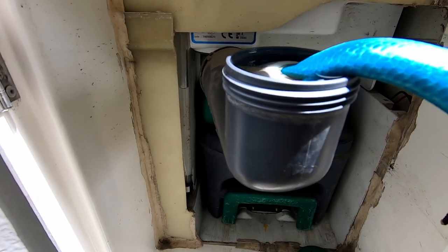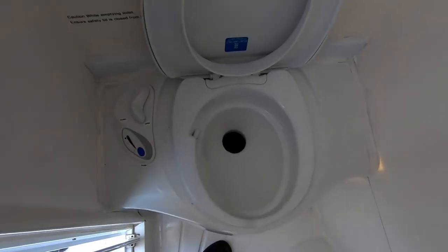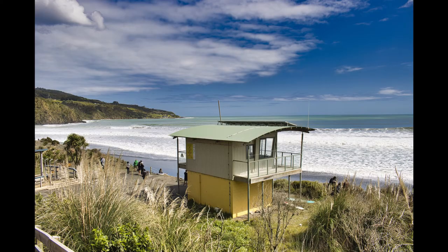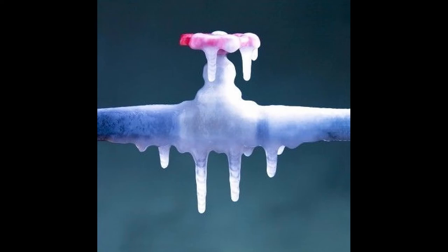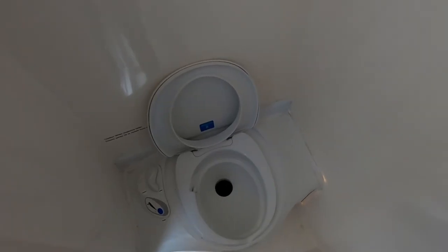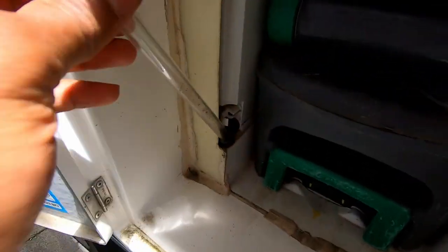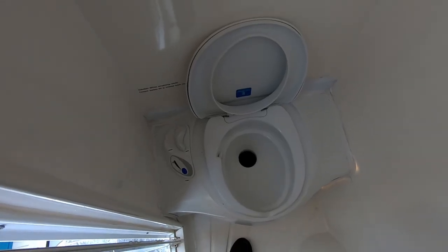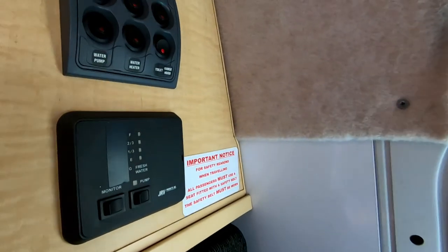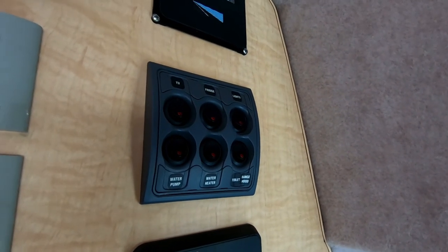Once this is full we'll go back inside and test the pump out. Open the toilet and as you can see it works perfectly. As a general rule of thumb, in New Zealand we don't normally bother draining out the flush tank because it doesn't get cold enough, at least on the North Island. But in Europe it's quite common, so for anyone not going to be using the camper for a few months, go outside and drain the tank like I showed you — also empty your water tanks — this will save you having to replace this pump due to mold buildup. When you're all done, don't forget to turn off your switch. Hope this video was of some help — if it was, please like and subscribe. Thanks for watching everyone.